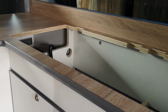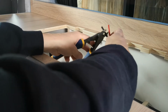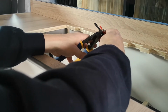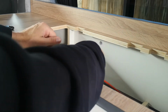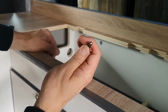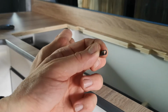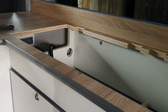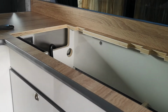These cables. What I'll normally do as a matter of course is cut the cables back 10-15 millimetres, just purely to give us clean ends. You know, this cable could have been sat on a reel for 6 months. You never know. And the difference in the colour from a fresh cut cable, I don't know if you can quite see really. But yeah, clean cut ends go a way to giving us a better connection. So we'll get the components ready for that now.